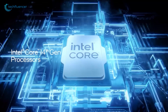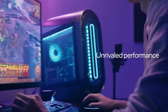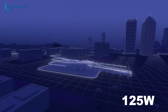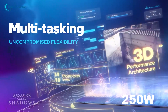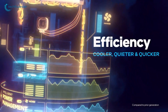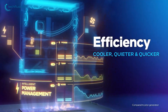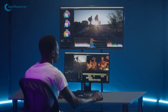Still, that doesn't tell the whole story. The E-cores in Arrow Lake are stronger than those in the Raptor Lake chips, and faster base clock speeds help keep the performance competitive. On the power side, both chips have a 125-watt base TDP. When pushed to their limits, the Core Ultra boosts to 250 watts, while the i9-14900K goes slightly higher at 253 watts. The real improvement with Arrow Lake is efficiency — Intel says the Core Ultra uses up to 80W less power during heavy use, which should mean cooler temperatures overall.